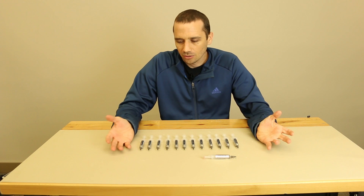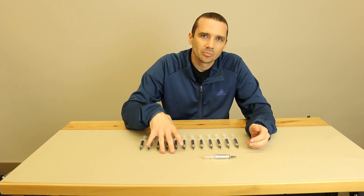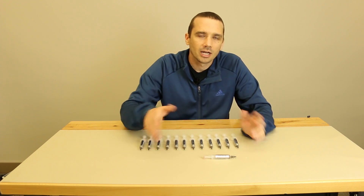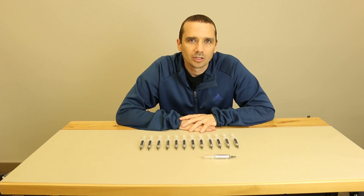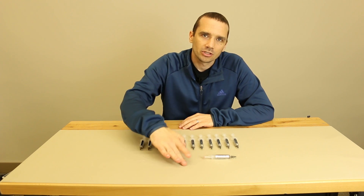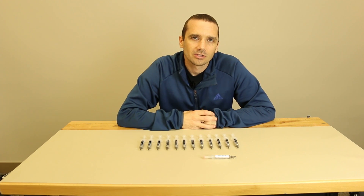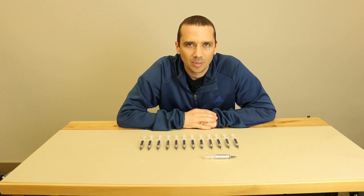This basically means you don't want to use it if there are any circuits near where the thermal paste is going to be that are uncovered, where the paste might get onto it and cross two circuits — then you're not going to want to use it in those cases. That said, there are very, very few times when that would even come into play. Generally you're using it on a CPU or GPU, on top of the shiny metal die, and there's nothing near there that's going to cause problems. We use it on PS4s and Xboxes, and there's nothing on a PS4 or Xbox APU that would ever cause a problem with it being slightly capacitive.